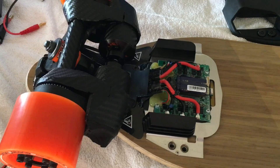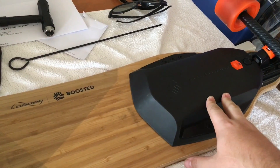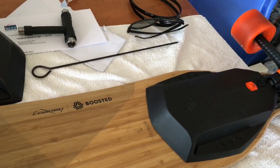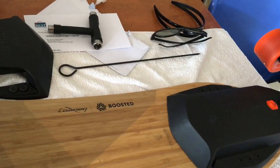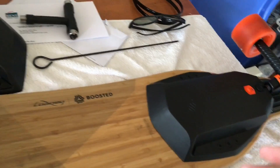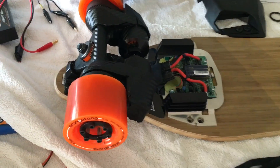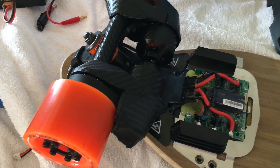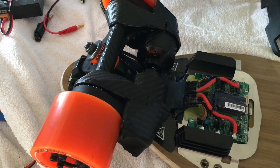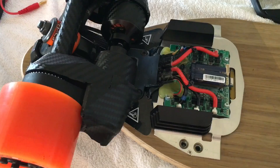In my calculations shown in the screenshot, I've done it at 43.2 volts, but this pack starts to decrease pretty much after you ride it up one hill, which means your top speed is limited. I've ridden this and the top speed really doesn't get limited until it's probably on about 30% charge, which means I really say it's about a 220 KV motor — giving a top speed of about 22 miles per hour. For the Dual — not the Dual Plus, but the Dual — I would say that there is some sort of software RPM limiting.